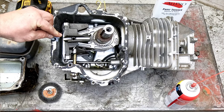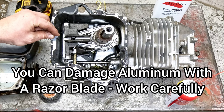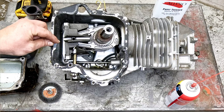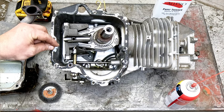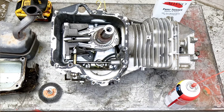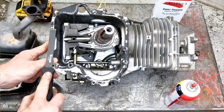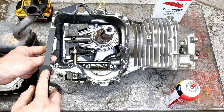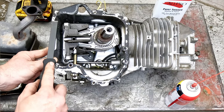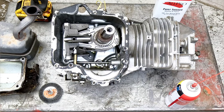Yes, it takes time, but if you hold it right and get good at it, it's extremely easy to get this stuff off. It's not a difficult process, but it is time consuming — you do have to have some patience or get pretty good at it. Another good one is the carbide scraper. Once you get good with it, it can work just as well, but you have to be careful — maybe practice on one that's junk. You have to be very careful because until you get real good at it, you can really mar up the metal and scratch it real bad.